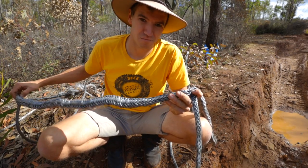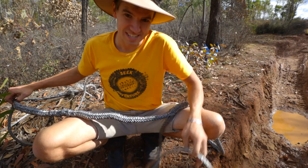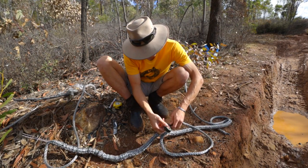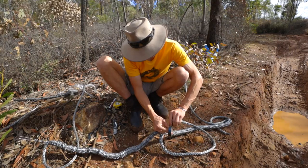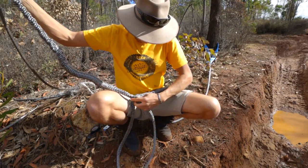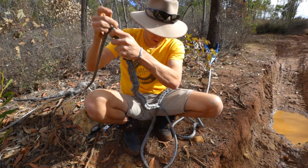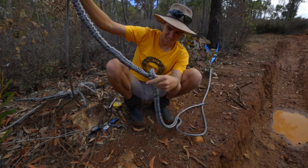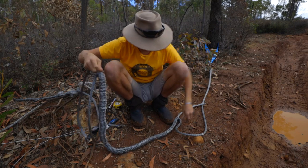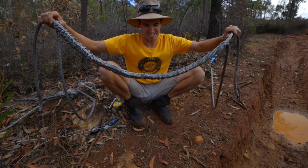We've pushed the fencing wire through all the way up to the mark on this rope, then attach the other tail to the fencing wire and pull it all the way back through — again, make sure there are no sharp edges when taping it. So now all we need to do is spread the dyneema a little bit so it can work its way in, then pull it through so we get this little loop. What you end up with now is what looks like a snake that's eating another snake.